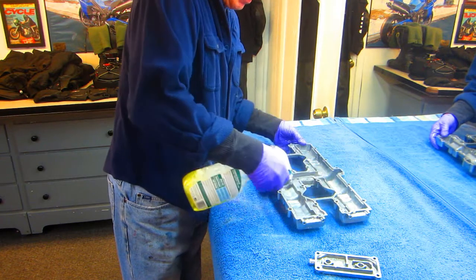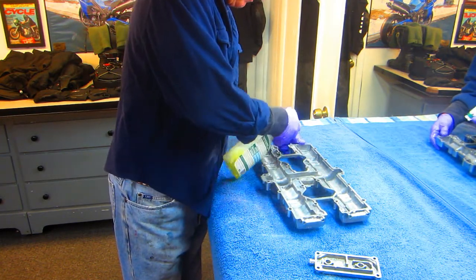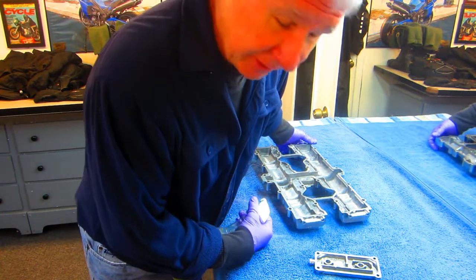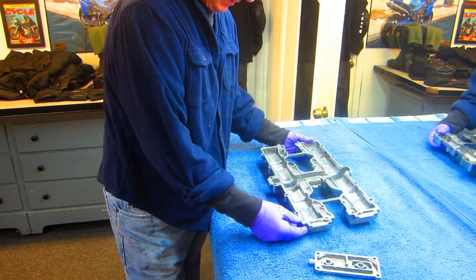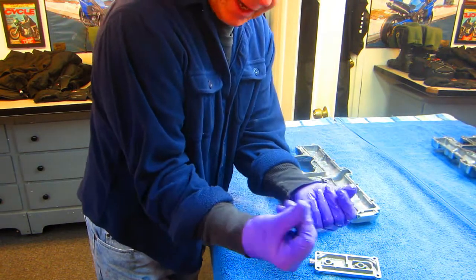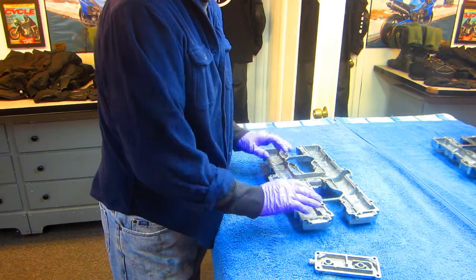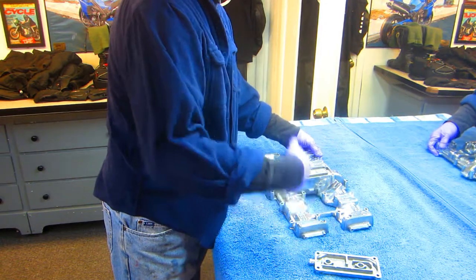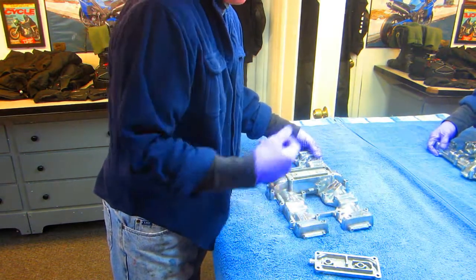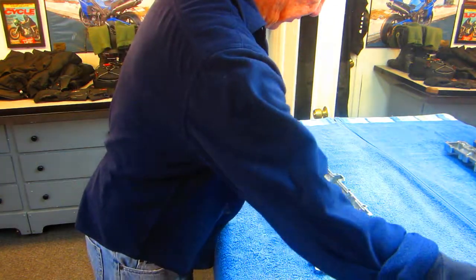Now here's what can happen if you're not real careful, or you don't realize what you're doing here. You've touched this grinding compound with your fingers. You've got it all in here from holding the part. Now what happens, all that compound's in there, you put it back on the engine, tighten it down, the oil starts slushing it through the, well, you can picture. Nothing good's gonna happen.